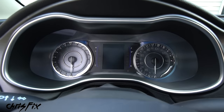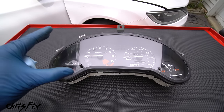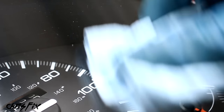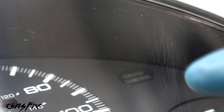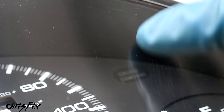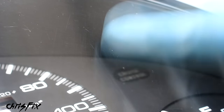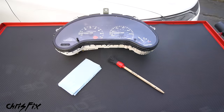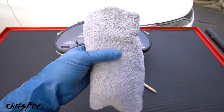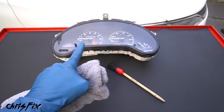Here's a quick demonstration: I'll wipe a Honda del Sol gauge bezel with a dry paper towel — you can see the scratches it creates. Now a damp microfiber towel pressed hard shows no scratching at all. A brush shows a little light scratching — not as bad as the paper towel but still not good. The proof is in the pudding, and that's why I like doing real-life tests like this. Stick to using your microfiber towel lightly misted with water to dust off the gauge bezel.